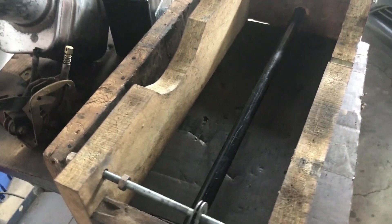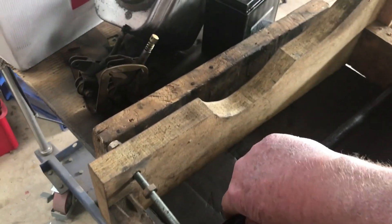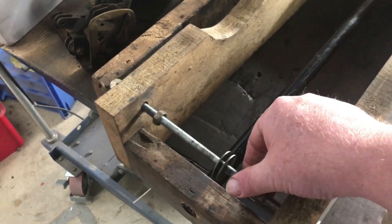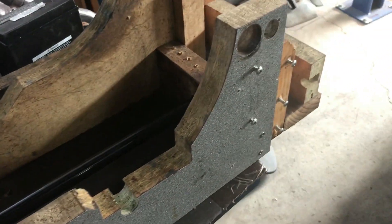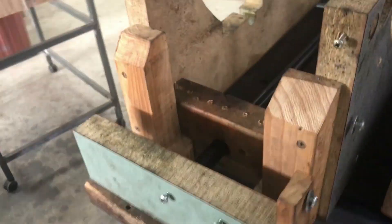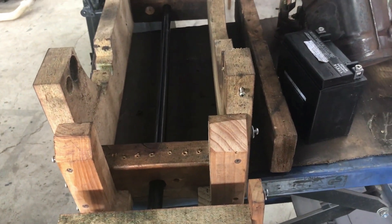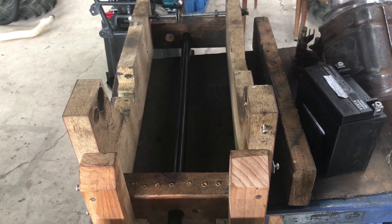Before the control levers are bolted down, I thought I'd just show the actual engine stand I'm using without the engine in it. That's the handlebar - I put a couple of holes in it through the gut so I could store the handlebar. This is the rear piece of threaded rod, and I use the actual rod for the front engine mount. The front engine mounts up there with a series of self-tapping screws in the side, and all that electrics and stuff attached to it, the battery box, screws in the front and more screws in that side. This screw stops the handlebar rotating. It was just thrown together at the time, and now I've got the pieces that allow it to be tipped over onto its left or right side, which is a handy option.